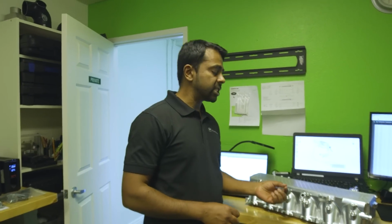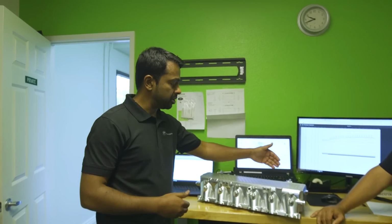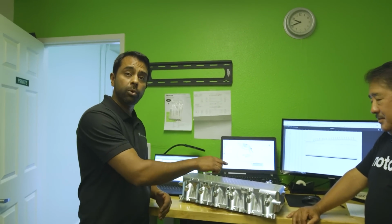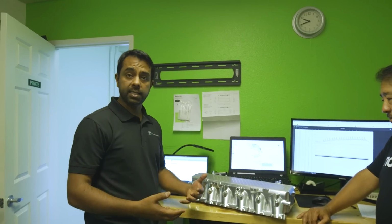Yeah, we put a lot of attention to the details for the fitment and placement of the original sensors, the wiring harness. There's also the opportunity to hide and tuck some of that if you want to. We've minimized some of the pads, the bosses for aesthetic appearance. We've given some great fitting locations for the mounting brackets and all the additional injector ports. So all in all, we've really paid attention to installation ease. How can you install this as simply and as easily as possible and not need a professional to necessarily install it?